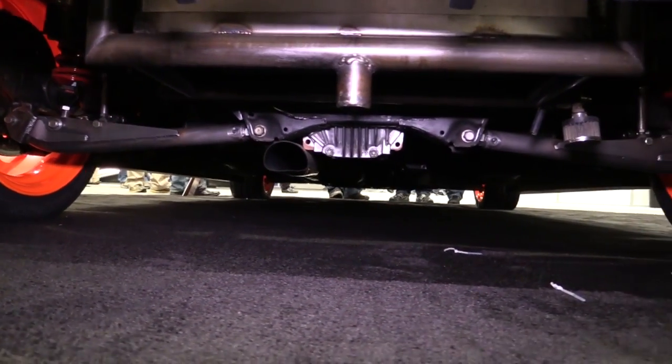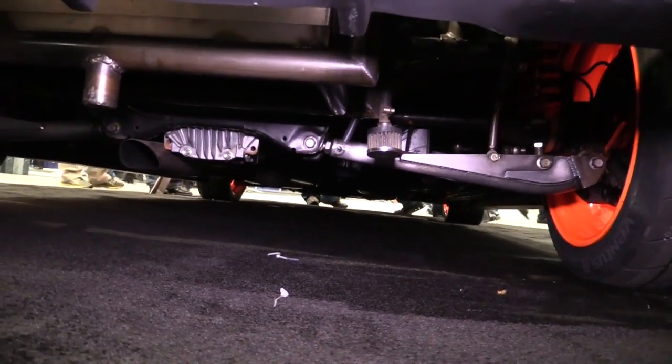How do you go about choosing your rear end ratio from track data? We want to make sure Frederick can stay pretty much floored in the high-speed parts of the track. If the car is sitting on the rev limiter a lot, we'll put a slightly longer gear in. If he's having trouble getting up to the RPM he needs in the slower sections, we'll add a bit more ratio. We change the whole rear end — we use units from a 1994 Toyota Supra JZ80. We normally run a 4.27 ratio but also use a 3.7. With the tube frame rear end, the guys can get it swapped in about 35 minutes.